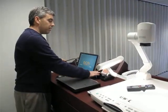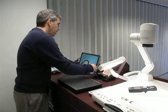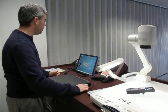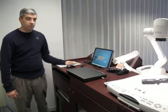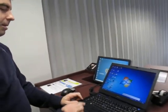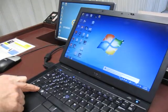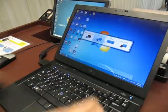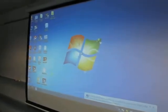The last thing to go through is the laptop. On the middle of the desk are all the connections you need. There's the video cable, which I'll plug into the side of my laptop, and an audio cable, which I'll plug into the headphone jack. Any device with a headphone jack can have that audio cable plugged into it. As long as you select laptop on the controller, it's going to switch both the video and the audio. When my laptop comes up, I'm going to make sure I'm sending the signal not only to my laptop but also to the screen. To ensure that, I'll hold down the function key and press F8. On some computers that will scroll through the options automatically; on mine it gives me a little menu. I choose the duplicate option, which puts the signal on my laptop and on the screen up in front of the class.